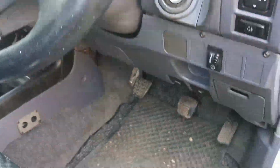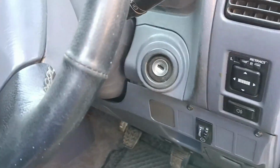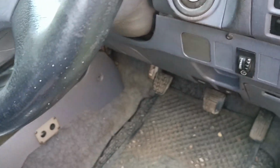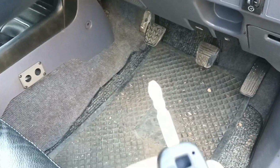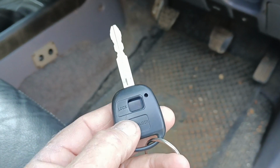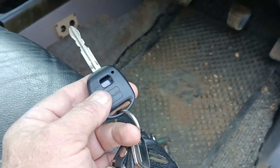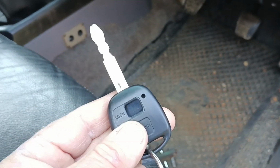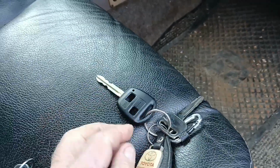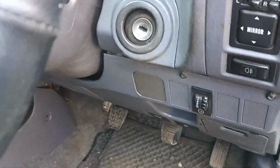Now, on your vehicle, there's a transponder. There's normally a transponder ring that sits around here, and that's simply a reader. It reads the code off the transponder, and it communicates with the ECU and says this has got a legit key and you can start. It has nothing to do with the actual remote, the central locking. Central locking is either a different portion of the computer, or it's a separate unit on its own, like a garage door receiver, that says it's locked, it's unlocked. That can talk to and activate your alarm and do all sorts of things, but it is a separate unit. So there are separate parts of the computer, or separate computers, and separate parts of your key. So there's generally your 3 components: the one that locks, the one that is a transponder that's read by the ring, and then your profile that actually turns the barrel.